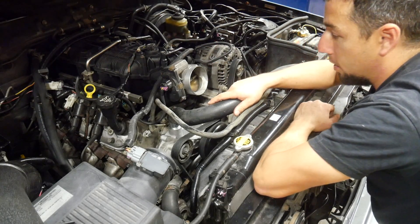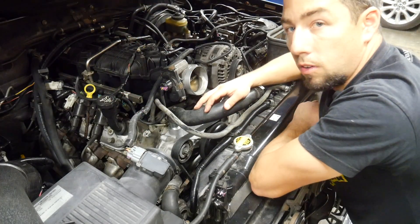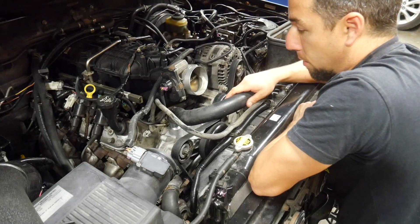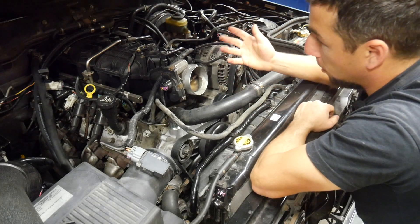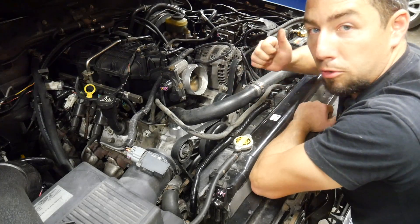It's on now, and I also revamped the heater hoses. I got rid of the factory Trailblazer heater hoses, which were just terrible, and went to AutoZone and got 3 feet of 3/4-inch and 3 feet of 5/8-inch hose — that's about the length you need for this swap. Everything fits and looks nice, and I put new clamps on it, so we should be leak-free.